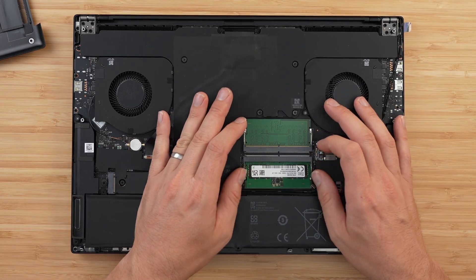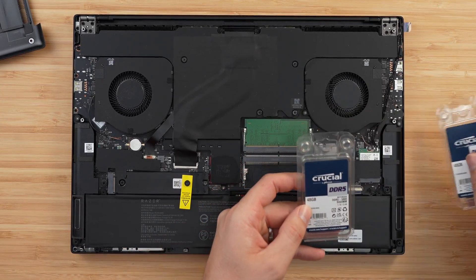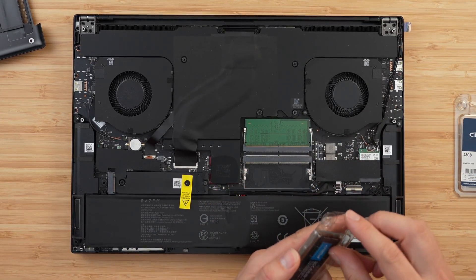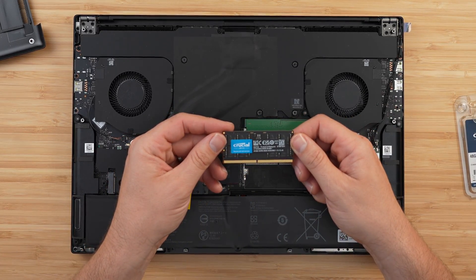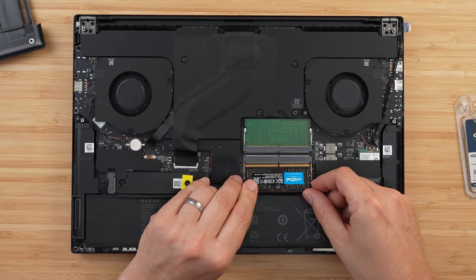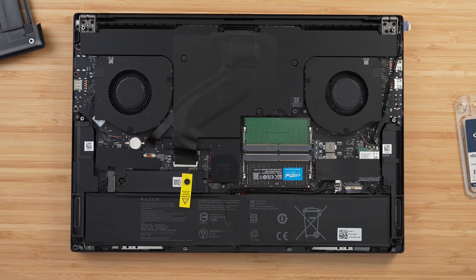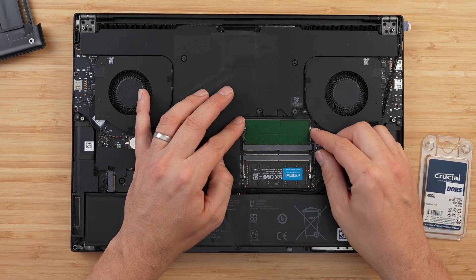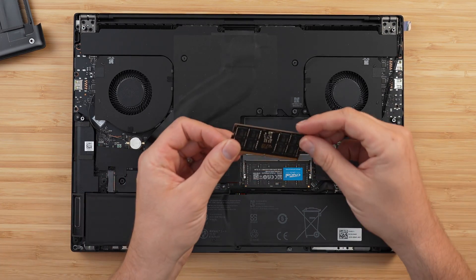Now I'm going to take the RAM out of the laptop. Pull the retaining clips either side of the RAM stick and it will literally pop out of the socket. Pick it up and pull it away at about 45 degrees from the socket. Put it safely to the side and insert the new RAM chip. It should be pretty obvious which way they go — there is a slot and they will only fit one way. Once you've found the correct orientation, slide it in at that 45-degree angle. Once it's in the socket, push it home until the clips snap nicely into place. Then move to the second chip and do the same — and that's your RAM installation completed.